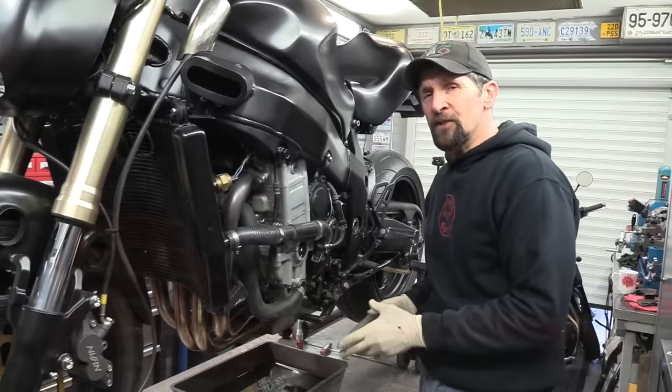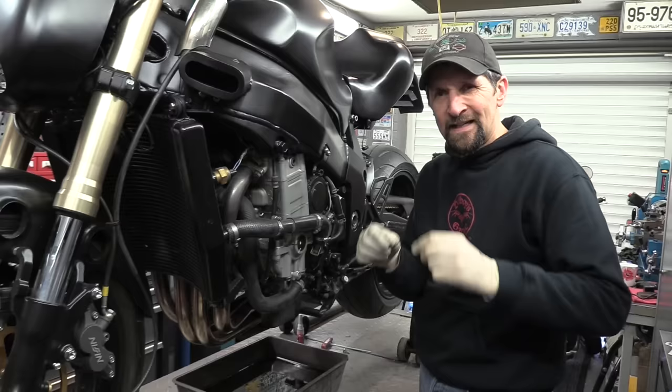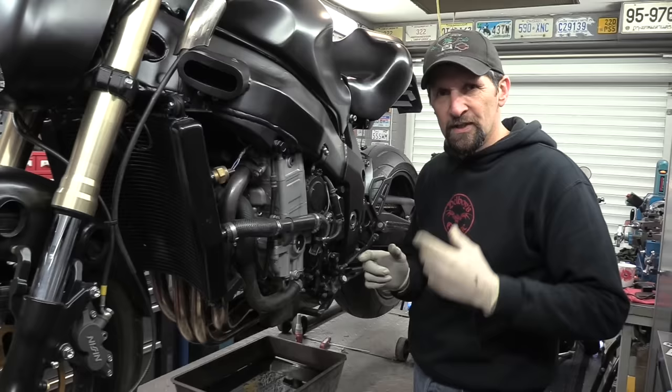That's the oil drained out and the filter changed in readiness. They've sent me a chrome one instead of a black one. Makes no difference whatsoever, the belly pan will cover it up. When you put an oil filter on, I'm sure you know this yourself, wet the surface of the oil filter, that rubber seal that's around it. They've got an oily Vaseline covering on them anyway, but dip it in the fresh new oil, get it all nice and oily. Oily surface on the front of the engine as well.